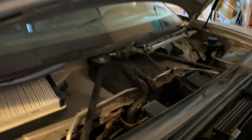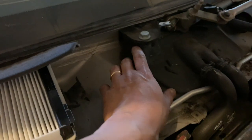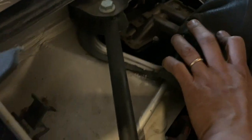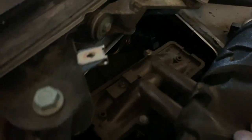Let me see if there's an easier way of doing this. Let's take a look to see how far down the heater core is. Without even taking out anything else, I just pull this out and — voila — I'm looking at the heater core. What I need to do is unhook these two clamps and hoses to get it out of the way, and in theory it's just held on by a few clips so I should be able to pull it straight up.